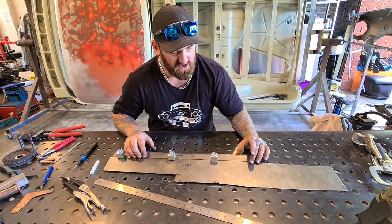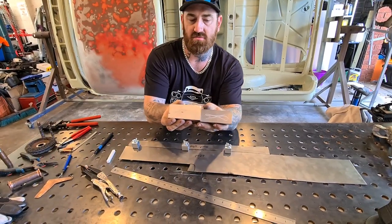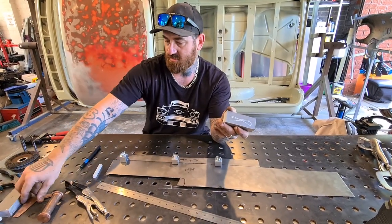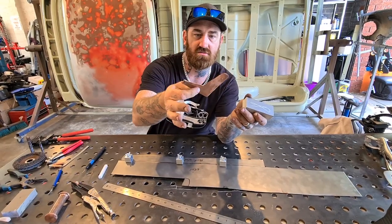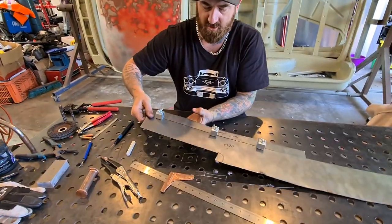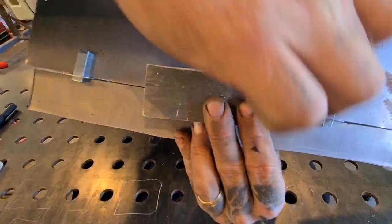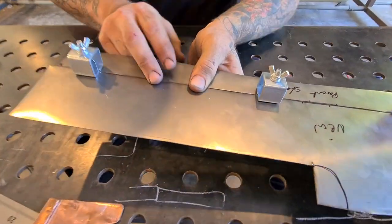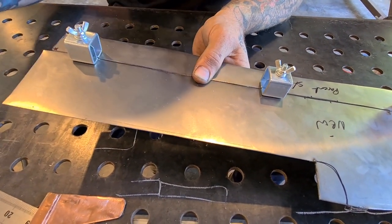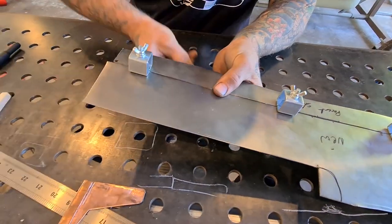After you've got the patch ready to go, if you have access to the back of the panel you can use aluminium blocks, copper blocks, or other non-ferrous blocks as heat sinks. A copper plate thicker than your material is always best — something that will absorb the heat. Put it against the back side so your seam is directly above it. The great thing about non-ferrous metal is your welding rod won't stick to it, it won't penetrate, and it absorbs heat too quickly for the weld to actually penetrate it. When you spot weld on it, it takes the heat out of your panel.